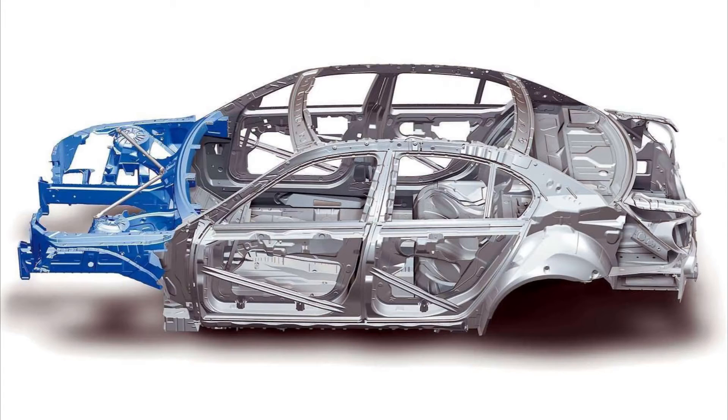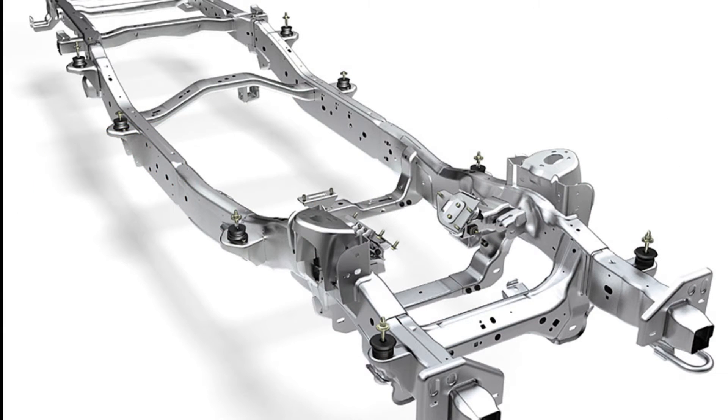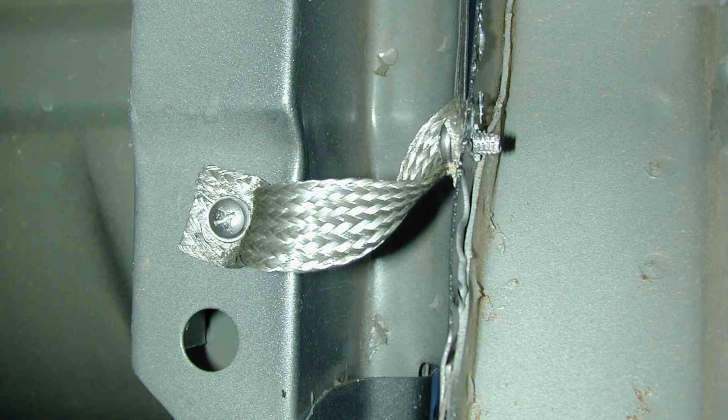However, most still have sound isolation undercarriages from the suspension, engine, transaxle, and exhaust system, etc. And these need to be bonded to maximize RF connectivity. Body-on-frame vehicles tend to be more bolted-on pieces, and this is especially true of pickups. No matter where you mount your antenna on a pickup, the bed should be bonded to the chassis on all four corners, and the cab on both sides. If you don't, you'll most likely be plagued by RF problems, some of which you won't even know you have.